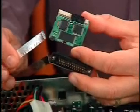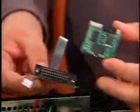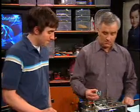And what does this BIOS do that you put on the chip? Well, what it does is it sits in front of the Microsoft BIOS. Right. So when you turn it on after you have it installed, it says, well, I'm a gaming machine, but I can also run third-party unsigned code. Right. You can hook a keyboard, a mouse up to me. You can do all kinds of stuff that you couldn't normally do with the Microsoft BIOS. So this is that circumventing device that Mark was talking about that actually circumvents the copy protection on the Microsoft Xbox.